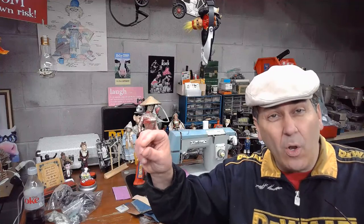You can get cracking. And sometimes it's just hairline, but it's kind of like a windshield. They used to call them spider cracks on windshields. The problem with cracks is over time, especially with the vibration of the sewing machine, they get longer and longer, and it compromises the strength and the stability of the sewing machine. So if you take it in slow stages, you can open up that cast material and port a hole, and the body of the machine is not compromised in any way.